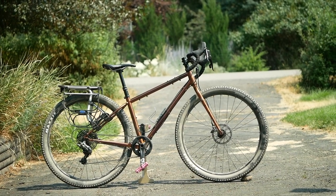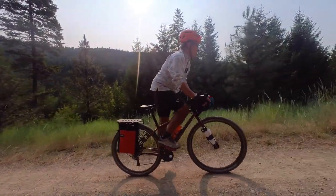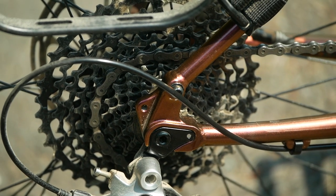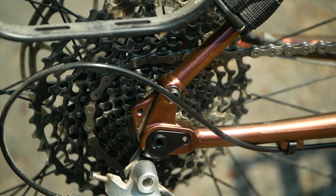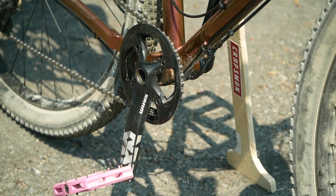In terms of dislikes, the bike does feel a little on the chunky side. With pedals, a cage, and a size 50 frame minus the Thule rack, it comes in at 28 and a half pounds — not a featherweight, and you feel that on steep stuff. That leads to my next dislike: the gearing. Because of its heavier base weight, once you put a load on it and climb in the mountains, it's going to be inadequately geared. I would have liked to see a mullet setup — maybe at least a 46, maybe a 48 or 50 in the back. You could change the front chainring from 36 to 32, but you lose your top end. I understand Kona is constrained by what SRAM offers on an OEM build.